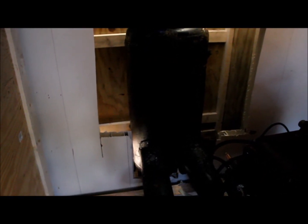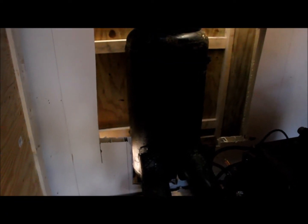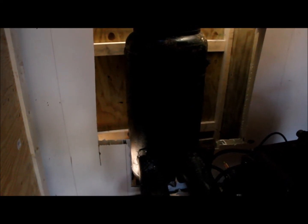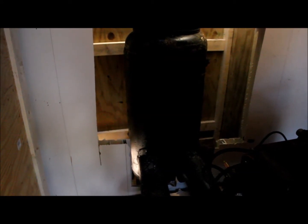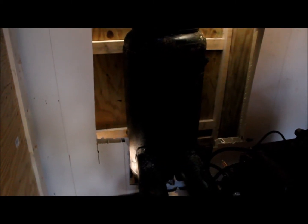And then I have this gigantic muffler that I've built. It's probably not as big as some of you have seen, but it's big enough, I hope. This first stage here is a three-chambered reactive muffler. All the different lengths of the chambers and the tubes connecting the chambers are quarter wavelengths and quarter wavelength times odd numbers — like quarters times three — trying to take care of frequencies in the 60 to 530 hertz range.